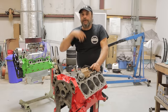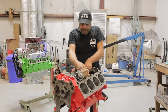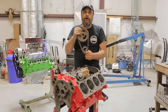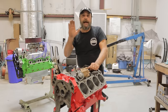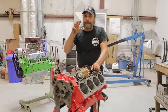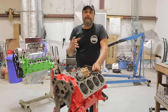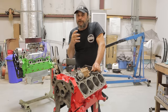As an engine goes through its life, things change. The timing chain will stretch a little bit, the gears will wear down, and the timing will actually become retarded — the cam timing will become retarded — and that hurts bottom-end power, that initial hit. In addition to retarding the camshaft one or two degrees because of the stretch, it's also retarding the distributor. So to compensate for that, as the engine ages, you want to advance it just a little bit.